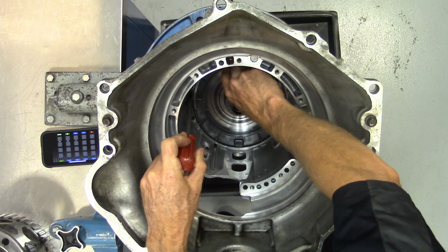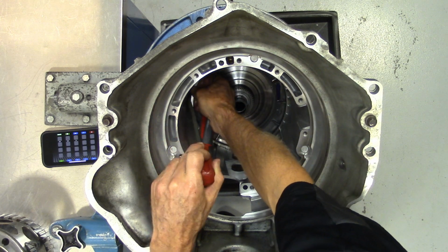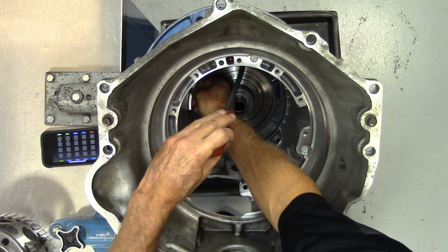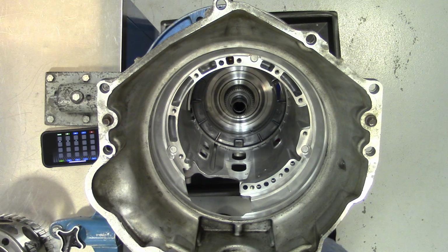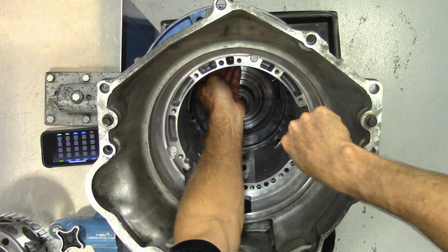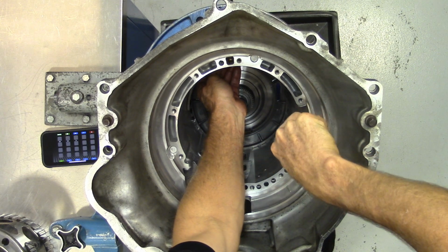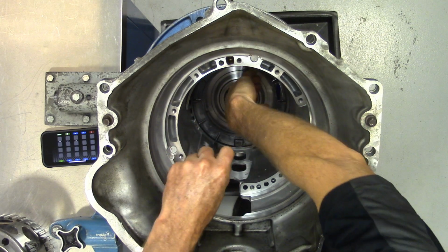There is actually a little bit of spring tension behind it, which will probably cause this to move up about 1/8 of an inch, not that much. The service manual, I think, does show using the tool to compress it to get the snap ring out, but I've had it apart so I know it doesn't shoot up at you violently or anything like that.